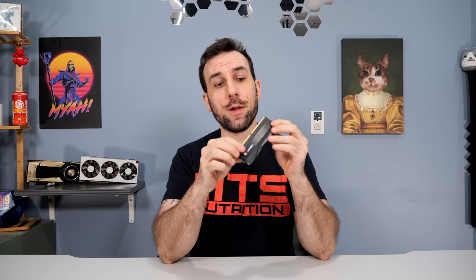I'm going to show you two ways to remove these things. The first way, we're just going to use a razor blade and cut the glue off. This is the riskier one because you have to pull on the heat sink as you cut the glue, and as you apply force pulling the heat sink away from the PCB, there is a chance you can break the solder connections between the memory chip and the PCB, resulting in a dead stick — I have done that before.